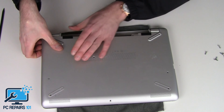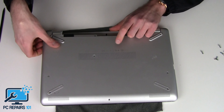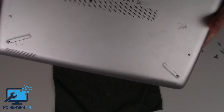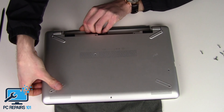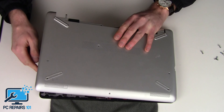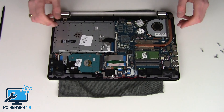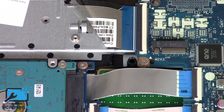I'll put it on its side on the microfiber cloth. I'm pushing my thumb one way and pulling my hand the other way — there are two little clips in there. You want to ease those clips out. Also be careful around where the USBs and HDMIs are so it doesn't get caught. Pop it off and there we go — the top is off. If you want to remove the RAM, that's very simple.